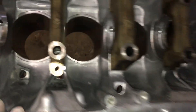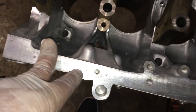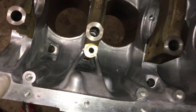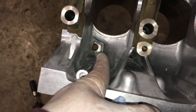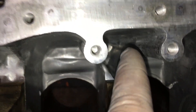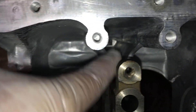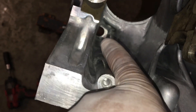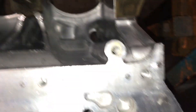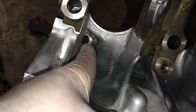Here's what I usually do to all my blocks to make things more efficient. See these holes right here? This is for the breather. You see how the edges have like little pieces around them? What I do is take a Dremel and actually go in and dremel that out up there to make it bigger — just for breathing purposes. I just like to do that.